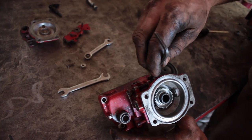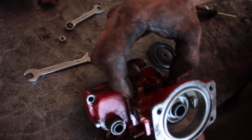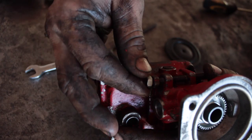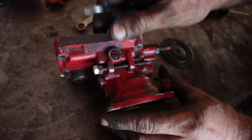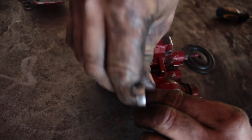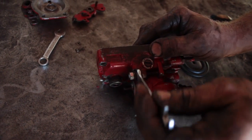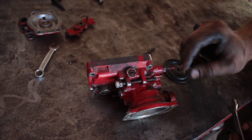This lever, because it's up against the side of the block, is very tight. So an easy way to pull this fuel stop out is to put a nut on it and then double nut the end. Lube it up so it spins nice and easy. Put your double nut on, take your wrench, tighten it and now you can wrench it out with your back nut like that. It's a lot easier than trying to get on the slotted end with a screwdriver at the back.